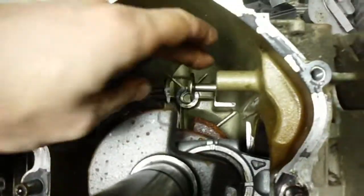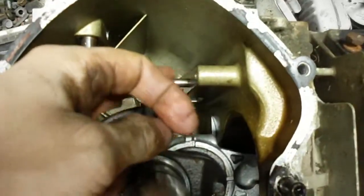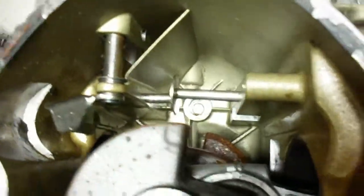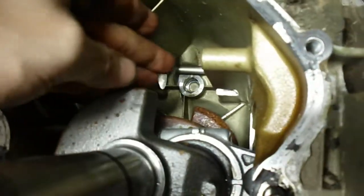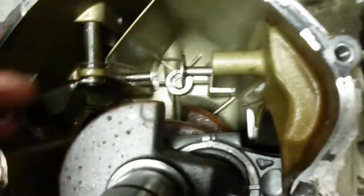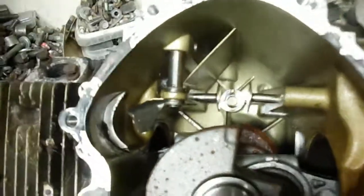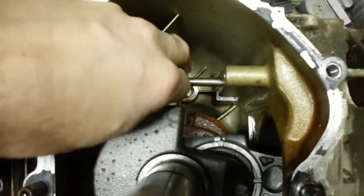One interesting feature on these engines - you can get the end valve tappets out, but you can't get the middle two out without compressing the valve because they hit one another. Even moved all the way over, it's still not disengaging. Since my intake valve seized, I'll have to compress the exhaust valve, or put a pry bar in it to get it to open that way.